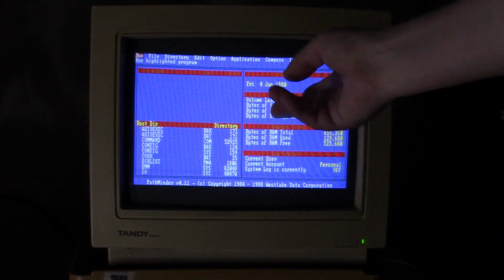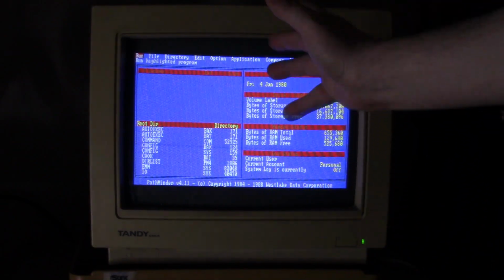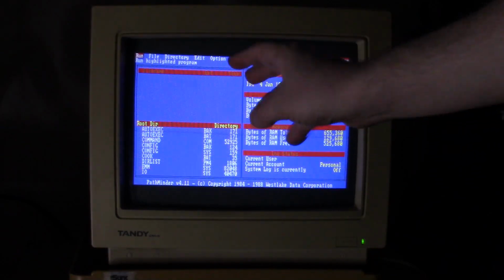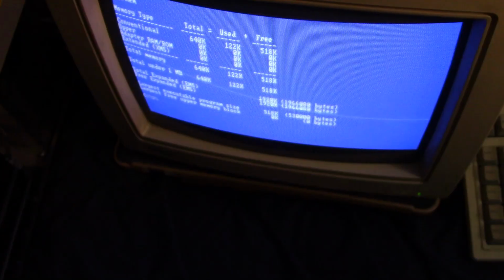It should count all the way up to the full 2 megabytes at that point. And I think that's what we want with these machines. Let me know for a 286 like this, primarily focused at gaming, if you want extended or expanded. I'm pretty sure I want extended. So I'm just going to rerun that software and setup, and then we'll get back to you.